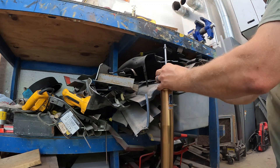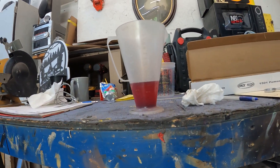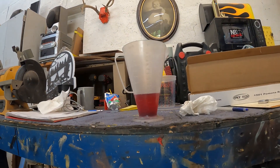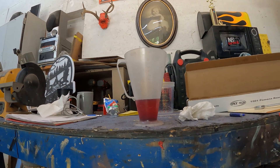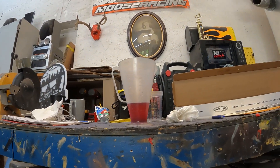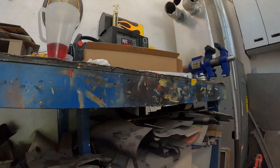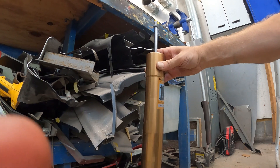He shows you how to drain all the oil. Like I said, all I did was take a cup and pour out 100cc's, because the fork tube has 600cc in it from the factory and Racetech recommends 500cc. So this fork tube should now be at 500cc.